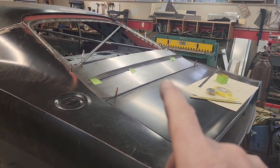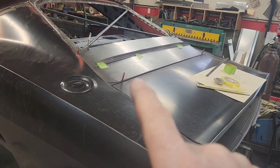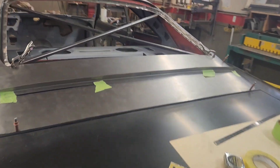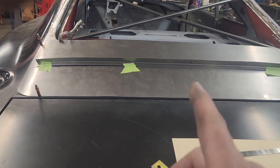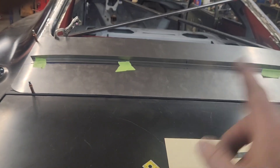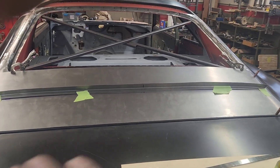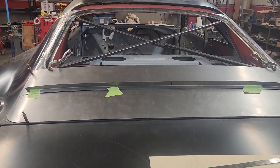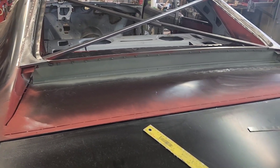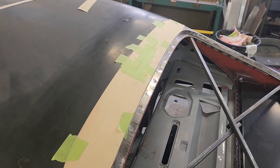I'm bending up this little template shape to give me a negative of what the brace needs to be underneath this piece. I'm working from the center mark out and getting the arc of one side. I have a pattern drawn on the bench that I'll use to replicate this side and get them to match so we have a symmetrical arc across here - it'll take out any little irregularities in the panel. While waiting for the weld-through primer and self-etching primer to dry, I've started making the paper pattern for the top closure panel.